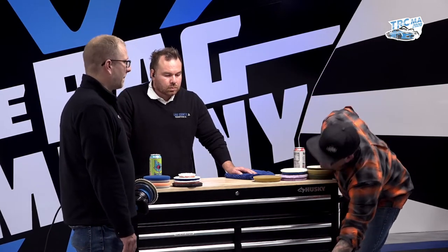Yeah, and like me and my guys would put a diluted APC, hang it on the handle. Yep. And then it would sit there, and so if they're working on something really heavy, they could give the pad, while it was on the tool, a couple sprays, set it back on the hanger, and then kind of help clean that pad out a little more, especially when we're working on single stage or, like you said, gel coats, where those pads just get filled. No, I think that's a brilliant idea, too.